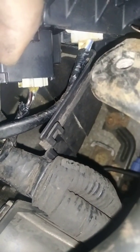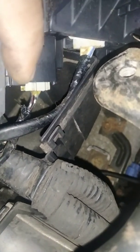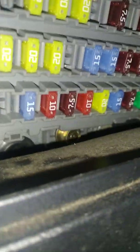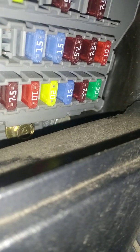Once you've verified that the ELD sensor is okay — if you don't have 12 volts on the first wire — that tells you to check fuse number 18 inside the compartment, which is going to be in the kick panel. Right there you can see number 17 and 18. Fuse number 18 is the 15-amp blue one right there.